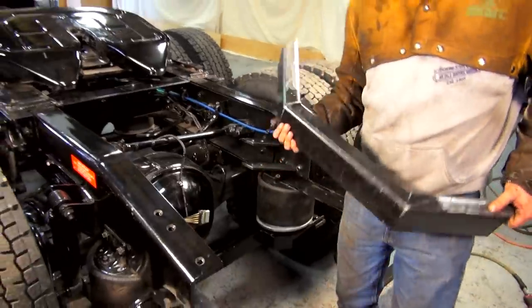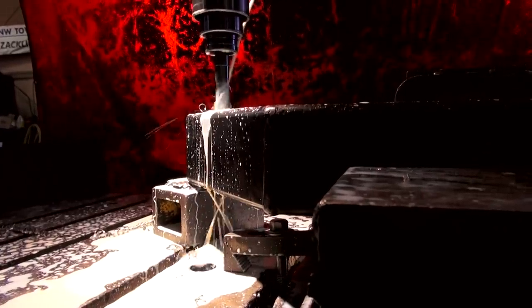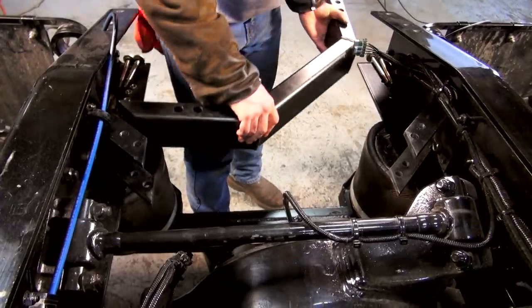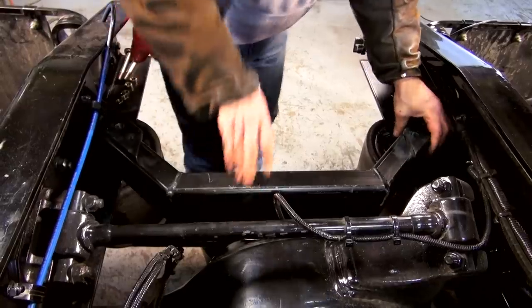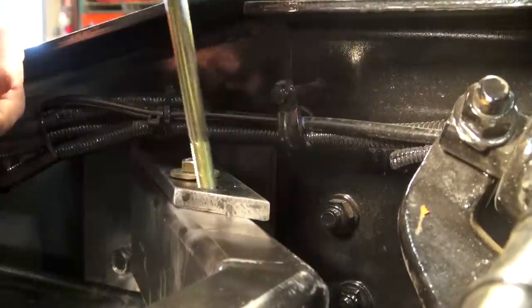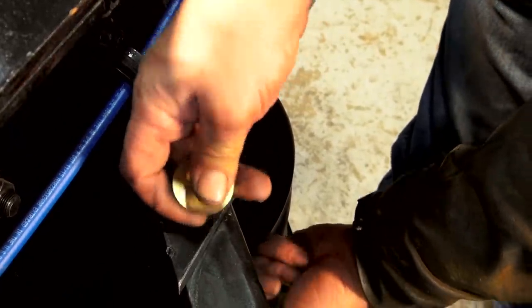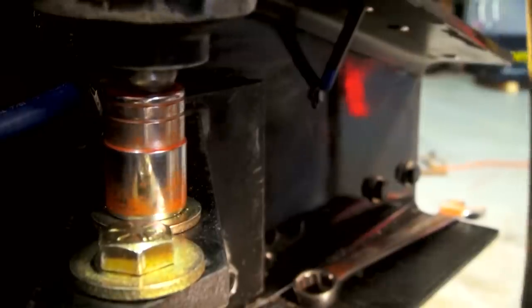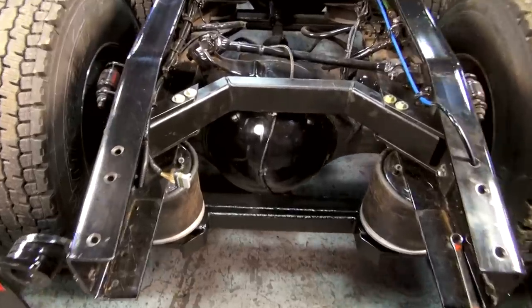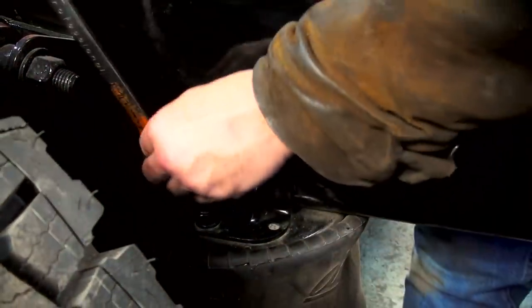All these steps can be done with a hand drill. Now we're going to drill 5/8 holes through the rear crossmember — two on each side, all the way through. Now we're doing a final fit-up and putting the bolts through. You'll put your bolts through from the top, just in case anything ever comes loose they'll stay in place. Now we're tightening everything down. Make sure when you're finished to double-check all your bolts and make sure they're tight.